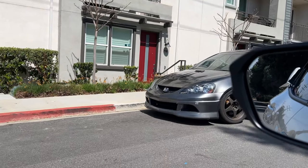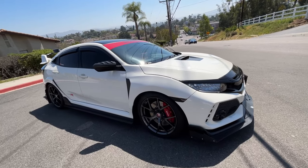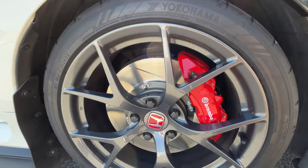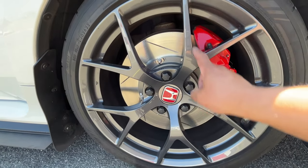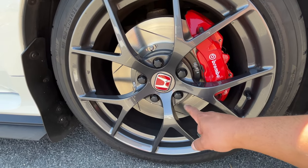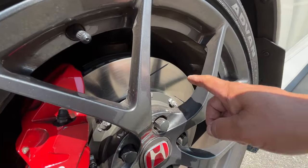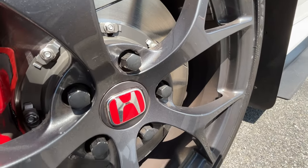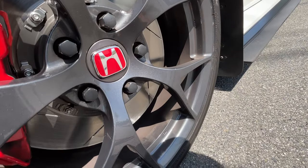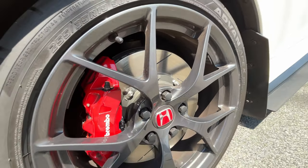It's been a little over 10 minutes, so let's take a look at the rotors. We're basically looking for even distribution when braking — no chips, no odd markings. They look fairly good on this side, and looking good on the other side as well. You can see these light scratches from the brake pads, but no bald spots or anything odd. Awesome job, Anthony!